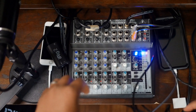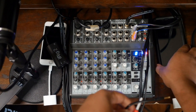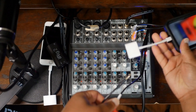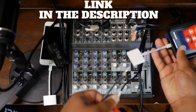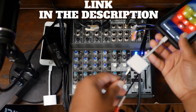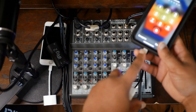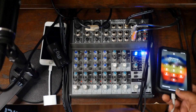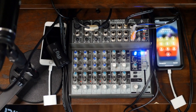Look on the side of the iRig and make sure the word 'through' is selected with the slider. Now it's time to connect the iRig to your phone. The newest iPhones only have lightning input available, so we're going to use a dual 3.5mm lightning iPhone adapter. These adapters made by Belkin are awesome — link in the description. Plug it into your iPhone and plug the iRig into the 3.5mm input of the adapter. I would recommend that you also plug a charger into the lightning input.